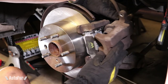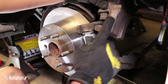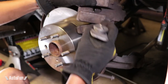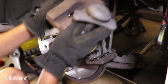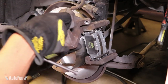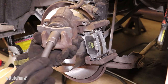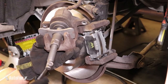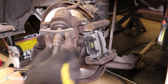Time to install the brake caliper, but I can't install it right away because the piston has come out as the brake pads were getting thinner. I have to push the piston back into place using a specialized tool. The key is to open up the brake fluid reservoir first to avoid popping anything. Sometimes you need to drain a little fluid if the reservoir is already full, since pushing the piston in will displace fluid. I go very slowly with the tool to avoid forcing the fluid at a fast rate — a nice steady rate — until it's fully pressed in.